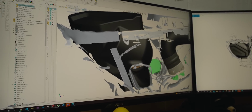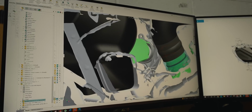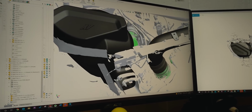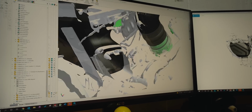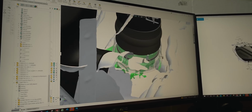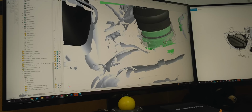We also were able to save one of those quick disconnect fitting adapters. This is a fairly complicated CNC piece. Because we removed this factory turbo snout, we were able to simplify it to just a barbed fitting over a silicone coupler design, versus an O-ring, clip, and complex machining. Right. On the passenger side. No, it's definitely very complicated. Yep. From a design aspect.